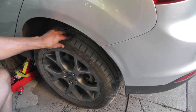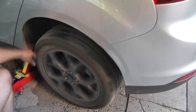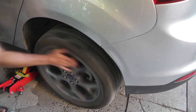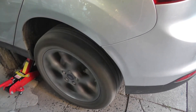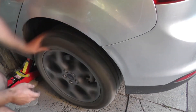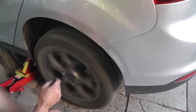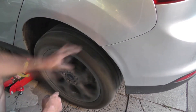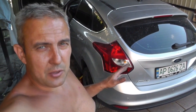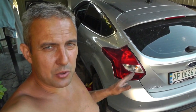Let's check if the brake pad is rubbing. Now let's press the brake a few times — check. Let's check after braking to see the results. There's no friction, and the wheel spins easily. After replacing the brake pads, you need to drive very carefully and avoid hard braking for the first 100 kilometers so they can bed in with the disc. After that, everything will settle down and you can drive normally.